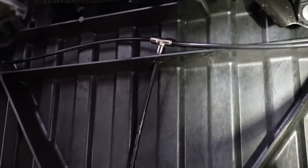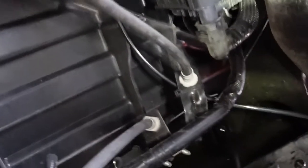So these are how my air lines are in. The line that runs down goes to the license plate where it all runs in, through a T-fitting that goes to the left and the right. I drilled holes in the bed to run the lines and secure them, which worked pretty well on the exhaust side — I wanted to tuck the air line up. That's how we have it run, down to the actual air bag. The other side is the same, but it's hard to see because of everything in the way.